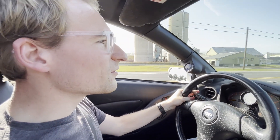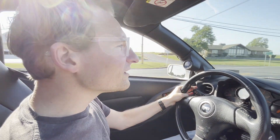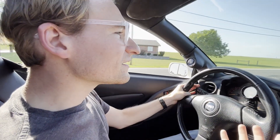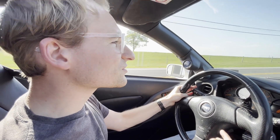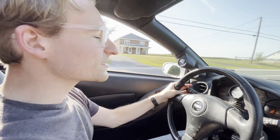So with a fixed pulley, you might not run into that. With a fixed pulley it'd be a lot more responsive, but because I have mine where it's not always on, whenever it's not on you have the resistance of it trying to suck air through a restrictive device. The supercharger is restrictive when it's not doing anything, so you get a laggy feeling when you're not on the supercharger.